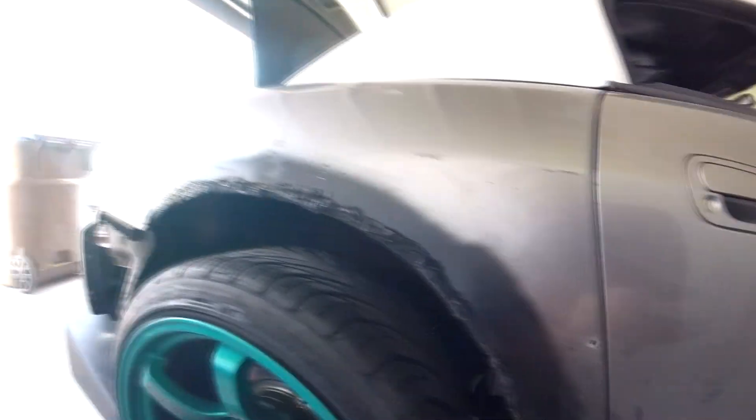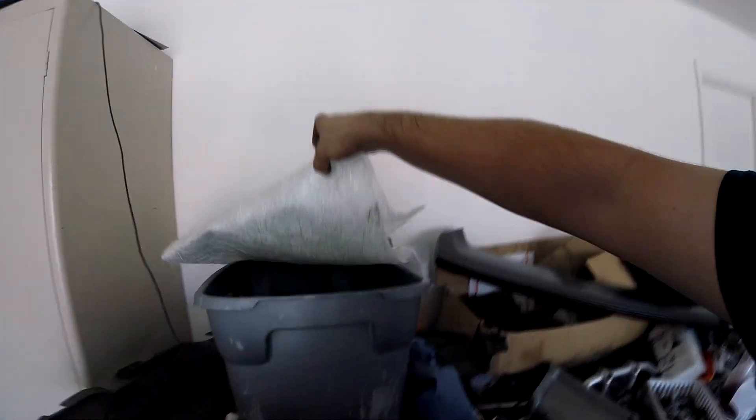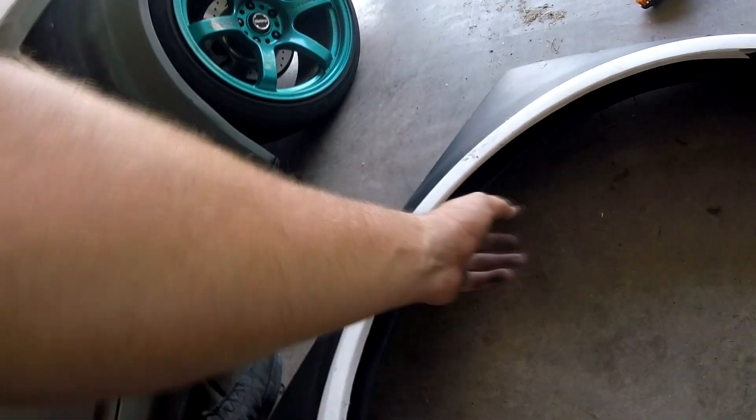So this is all the burnt rubber I was talking about — it looks like a drift car under here from me rubbing the tires on the old set. You can see how much room there is now. The car is fully on the ground. For the people that watch the M3 videos, this is like PTSD — this fiberglass mat goes in multiple directions. While the screws are in, I'll be lightly sanding this just to give it something to grab onto, then lay a bunch of pieces of mat with resin all around. Then make sure it's strong, take out all the screws, and from the inside flip it over and cut all the excess over fender off so it won't have that rubbing problem. Basically it's just Bondo, Bondo, Bondo and fiberglass from inside. It's not that fun — it's tedious — but that's what we're doing.